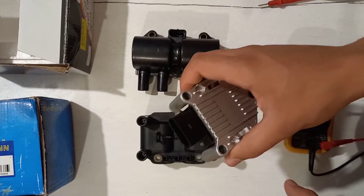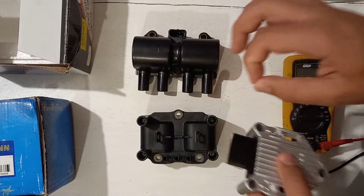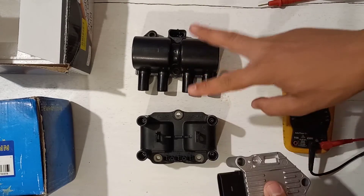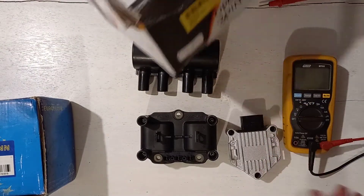You could also get a Bosch 211 four-channel ignition module to drive dumb coils, according to people on the Speeduino Facebook group. Basically these two coils are exactly the same underneath, and without the ignition module you can't drive either one via the ECU.